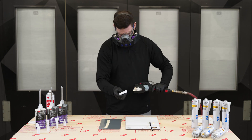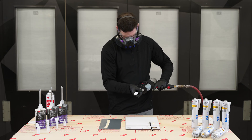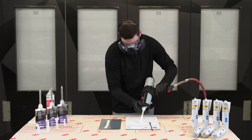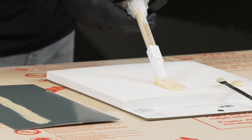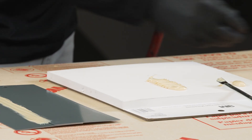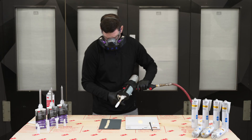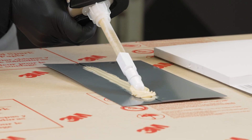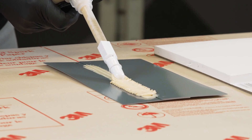Then I'm going to come back over with my OEM match ripple tip. I'm going to test that bead again to make sure the appearance is how I want it before I go to the vehicle, and that appearance replicates what I see on other parts of the vehicle. I'm going to come back to the panel and apply an OEM match bead right to that panel to get the appearance I'm looking for. You can see it's laying out very nicely, and now I have a joint that's functionally sealed over 2K epoxy and an appearance that matches the rest of the vehicle.